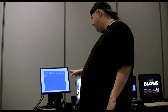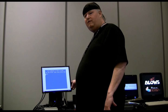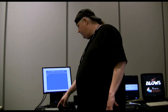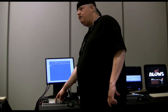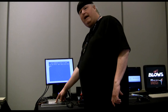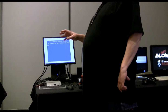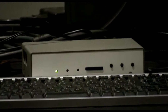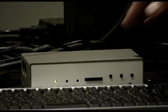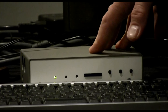But I have a lot of fun with this system. It runs really well, runs the software really well. You just take the SD card and plug that into the PC. It's just a regular FAT32 formatted SD card, so you put all your cores on there, and you just download them off the internet on your PC and dump them over to the SD card with the SD card reader. Same way with all the D64 images and ADFs, and this will also do HDF files.